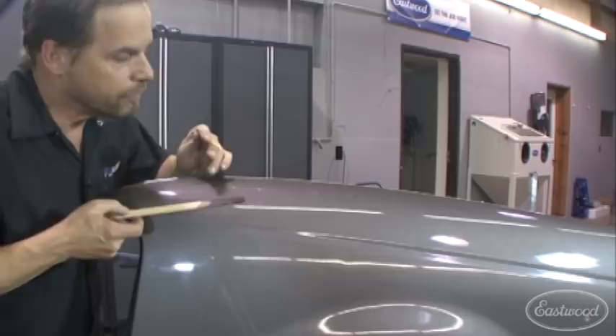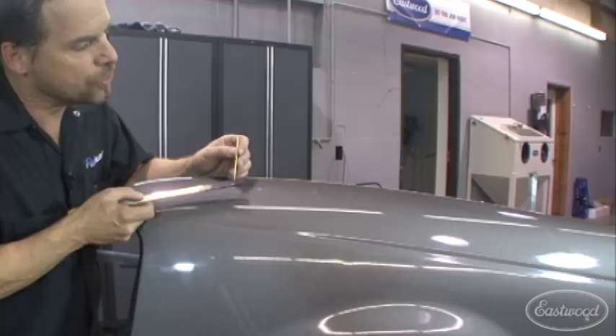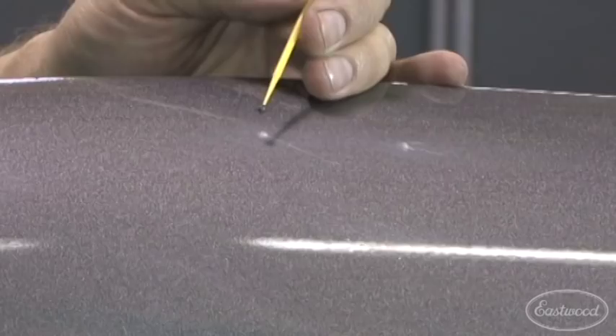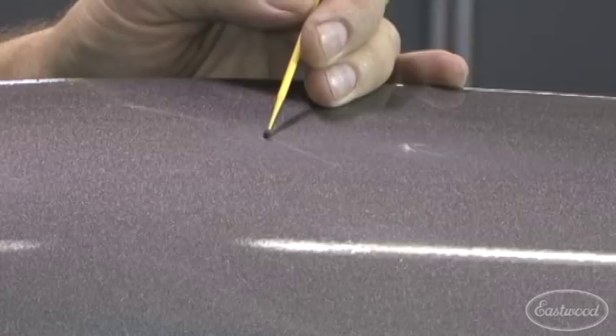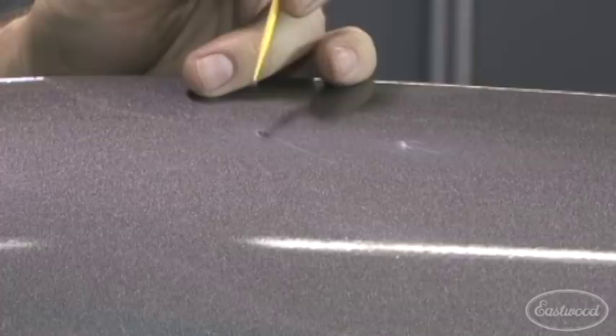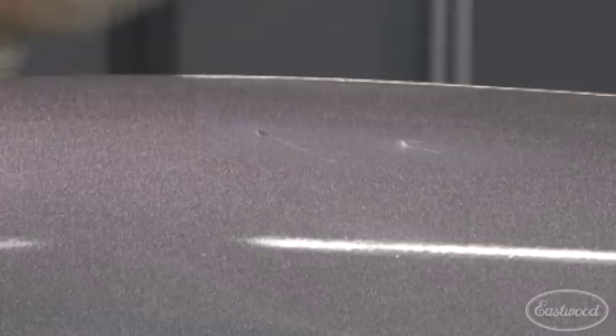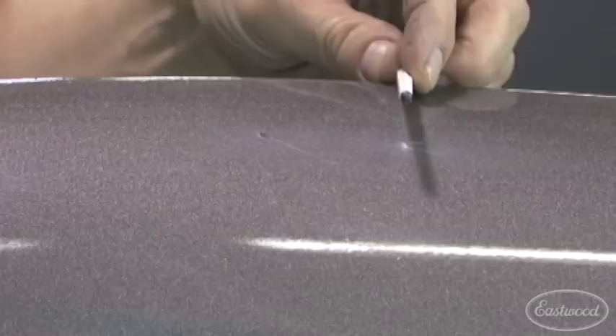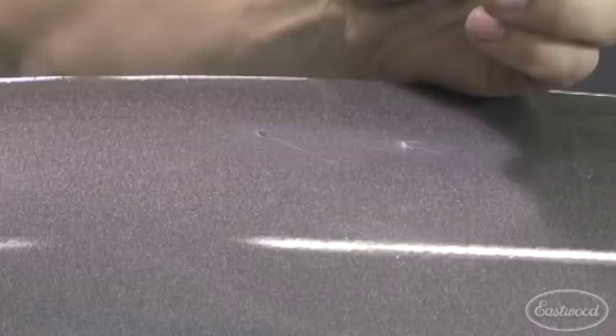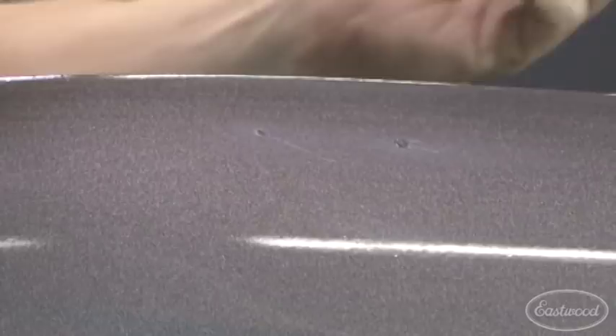I've got a little bit of base coat on the paint paddle and a couple of different touch-up brushes. This brush I picked up from a hobby shop — it's got a very small soft end and it makes a really nice job of putting that paint down in the chip. Just give it a touch, make sure everything's covered, and don't go nuts with paint. You want a bit of a cavity there to hold on to the clear, because this is a base coat clear coat touch-up. Here's another brush — the conventional typical modeler's brush. I don't like using the bristle end; it holds too much paint and flows out and makes too much of a mess. I use the back end of it. Just touch the end into the paint paddle and one touch usually does it.